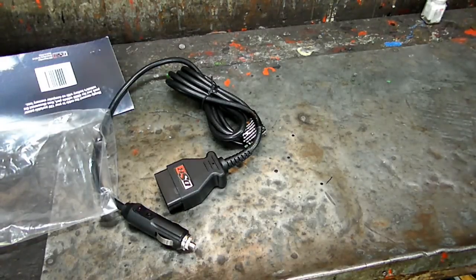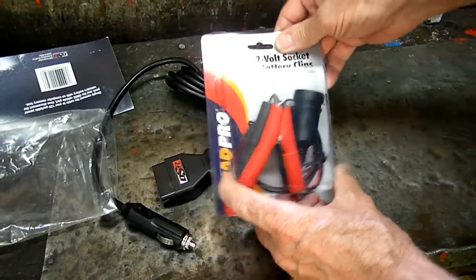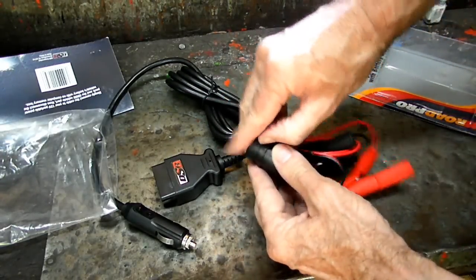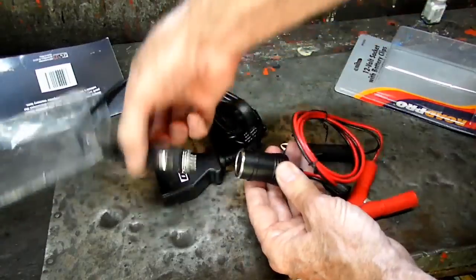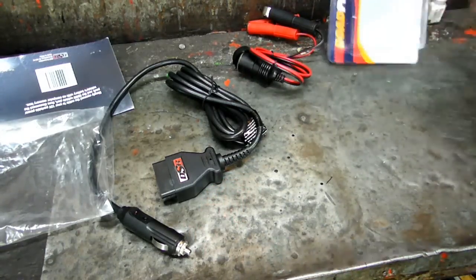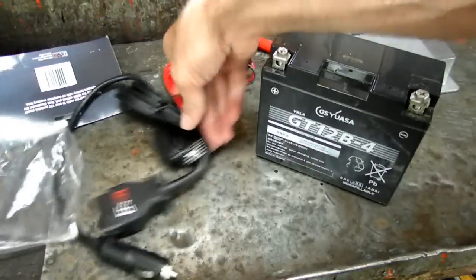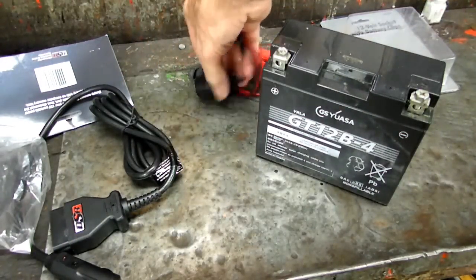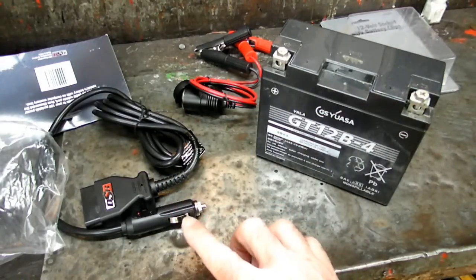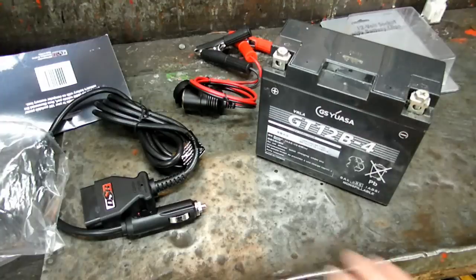What I'm going to do is use that tool with this tool. We got the piece right here — the socket. See that? We'll just put that right in there. We got some alligator clips, and right over here I have a motorcycle battery, so that should work pretty good. We'll clip this onto the battery, and now we'll have 12 volts. We'll plug this tool into the OBD2 port and we should be able to take the battery off and not lose any of our memory in the computer — radio presets, anything like that. So let's try it out.